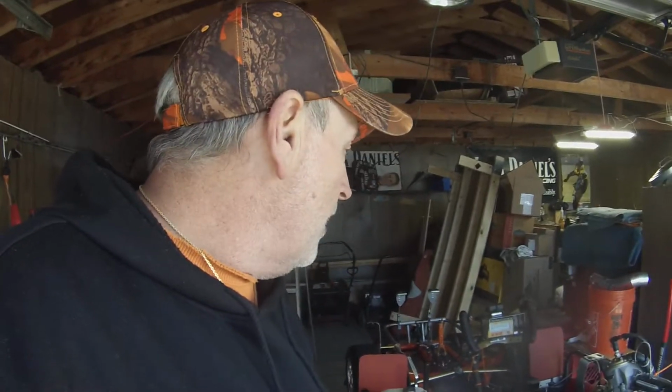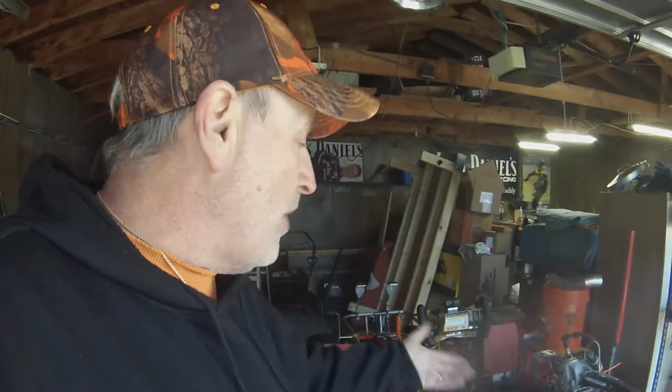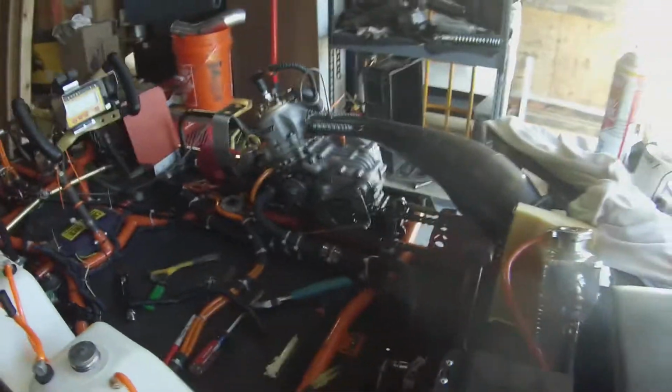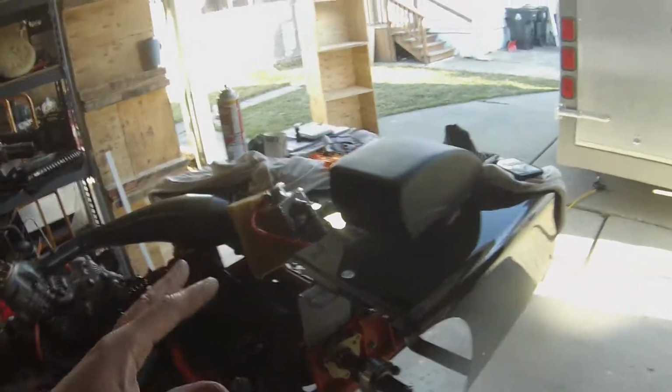And we'll get a better idea of what our water temperature is doing. We really don't want to continue chasing this thing. It really does kind of suck that we don't know what our water's doing. At this point, we think we can go past the 22-minute mark and not get the ignition misfire, because we think we're cool enough now. We're not reaching the 170s, but we still don't know exactly what's going on. So we would like to know these things. This, to me, is just not ideal, especially for a Daytona setup.